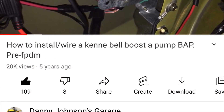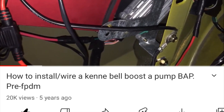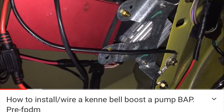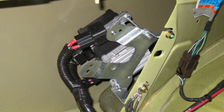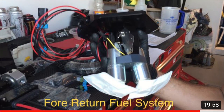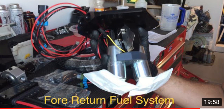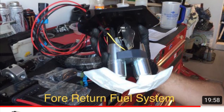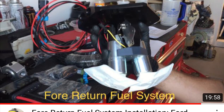Here's what it looks like — the boost pump, the red box. I have a video for that in the description to show you what it looks like and how to wire it up. I decided to go with the Black 306 because it was as simple as unplugging it and plugging the new one in. You can piggyback two of them together and rewire — there are kits to do that. Or I also have a video showing how to change from a returnless fuel system, which will bypass a lot of this; you won't even need the FPDM anymore as you go to a return fuel system.